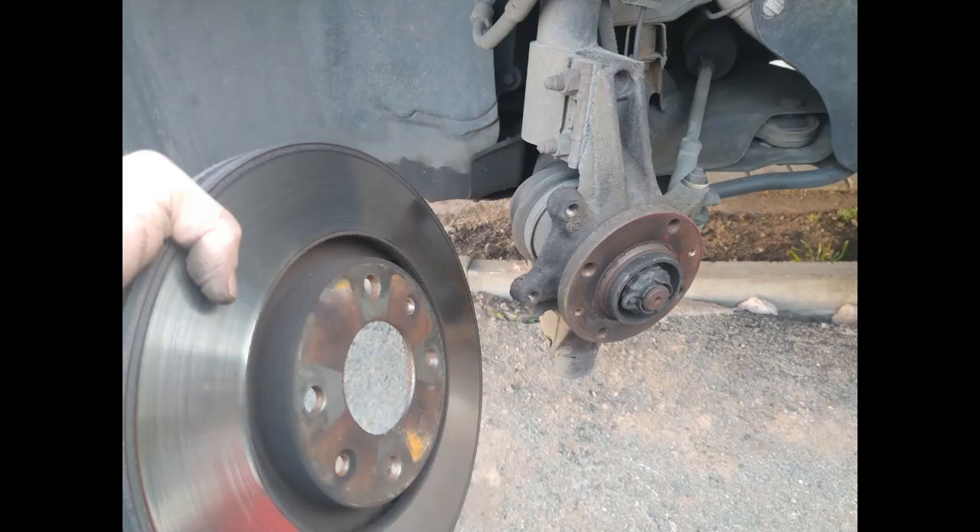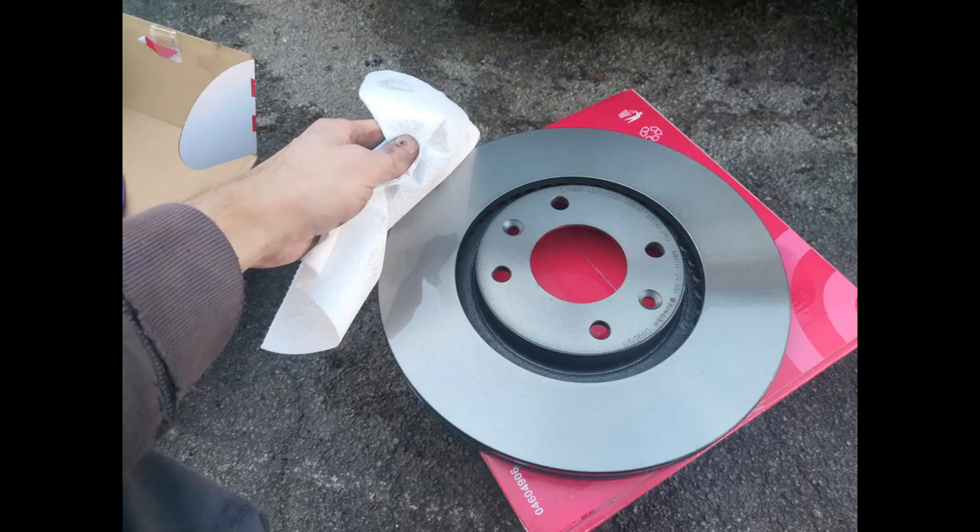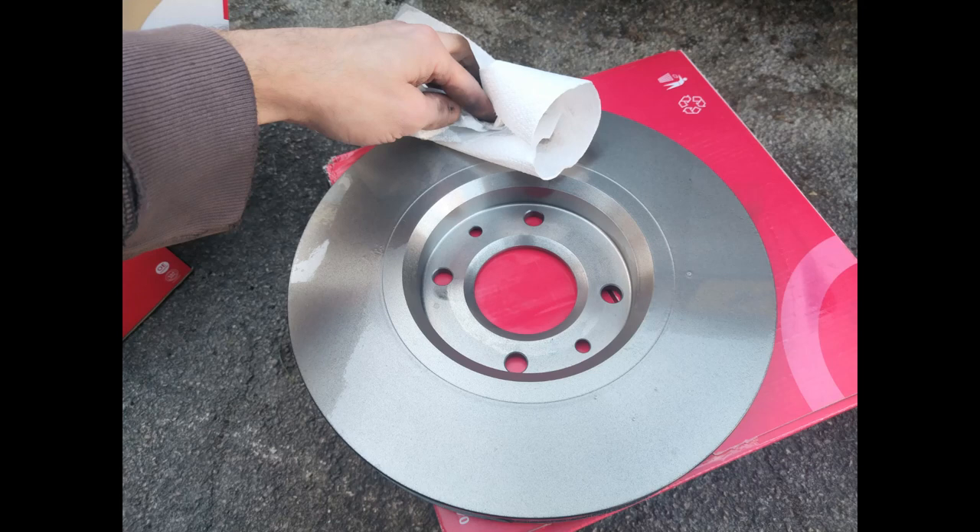You're now in a position to remove the disc, which should just pull quite simply off the hub. Wherever you are fitting your new discs - I hadn't got any brake cleaner with me, but carb cleaner is just as good. You just want to spray over the disc surface and give them a wipe just to remove any grease or residue put on at the factory to keep the discs bright - they quite often put a little film over there just to stop them corroding.